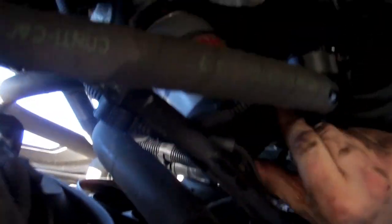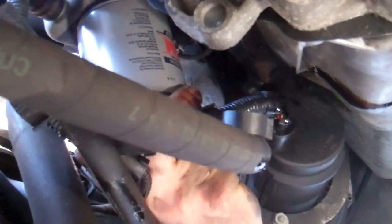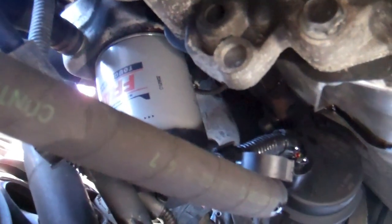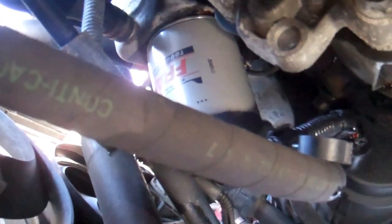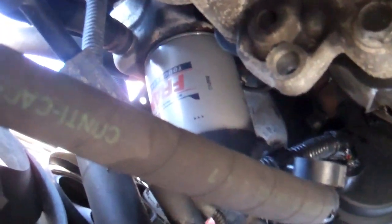Now we get back on the car as Kiefer's is installing the oil filter. You do not have to make it super tight — just about half a turn after it gets snug. Just hand snug, not hand tight. It does not have to be on like Superman. If it was like Superman, it would be more like a crushed soda can.